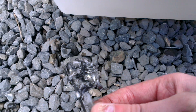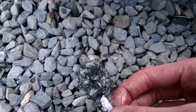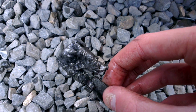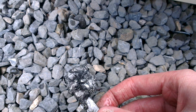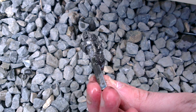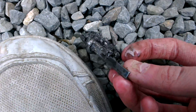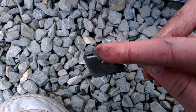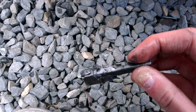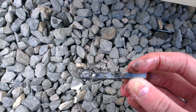Normally they're on the drain plugs but in the Jazz gearboxes they're not. As you can see, all the metal filings on there. Obviously these do get a bit of filings on them but should not have as many as this. This gearbox more or less ate itself — there's bits of bearing just there, and all the metal filings off the gears that blew up.